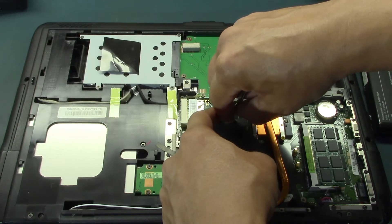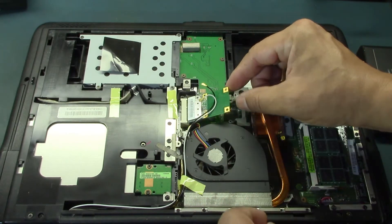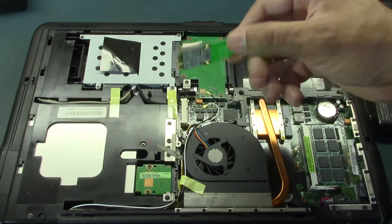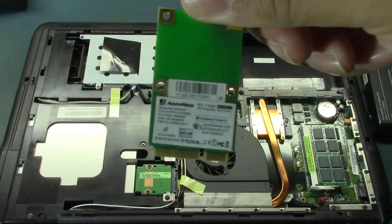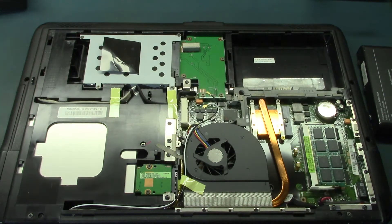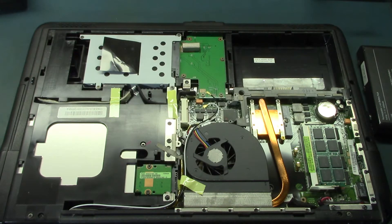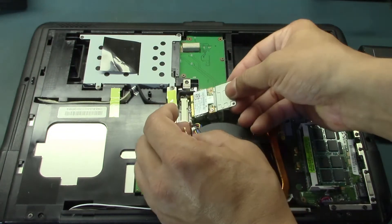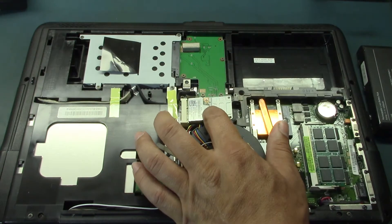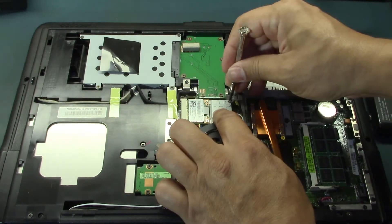Put it down here because it will want to lift. Just lift it like so and pull it. This is our Wi-Fi card — the Wi-Fi card that the Asus had installed from factory. We are going to be replacing it with an AR5-B225. For those that want to search what kind of card we are installing, this came from a Dell laptop and will upgrade our system to have Bluetooth.